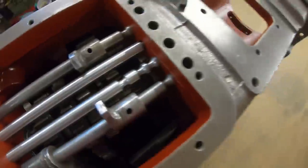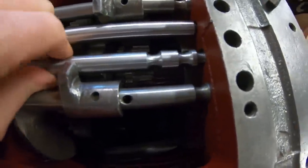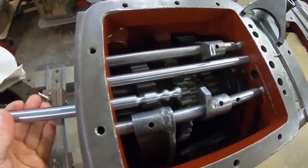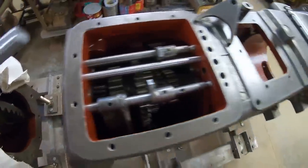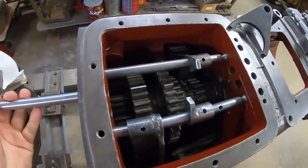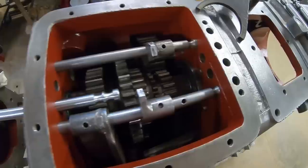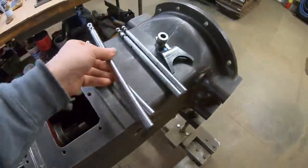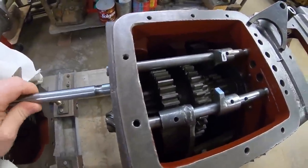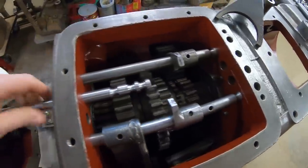Okay, and it's not as bad as the other one. You can lift it and started in, but it's really tight. So I was like, what's going on here? So I did a little bit of a test. Let's try number four rail in the 2-3 slot. Same thing. All right. Now let's try the new 2-3 rail in the 4 slot. See that? That is just how it's supposed to be.